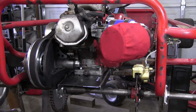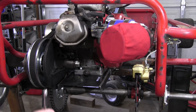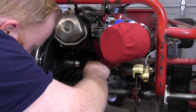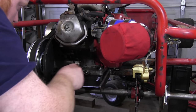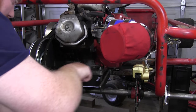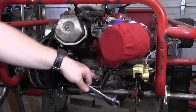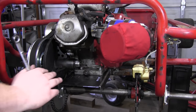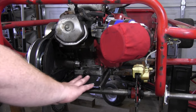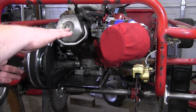The chain's pretty tight — I like mine tight because the chain's going to stretch a little bit once you ride the go-kart some, so I always get my chain pretty well tight and it'll loosen itself up after stretching. I always tighten my outside bolts first — the two bolts on the side of the engine opposite the torque converter — just in case your engine plate isn't perfectly level. It'll pull that chain tight before you tighten the inside, which will pull it back down.